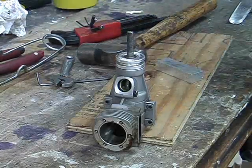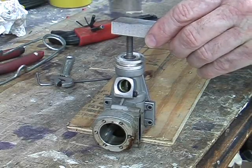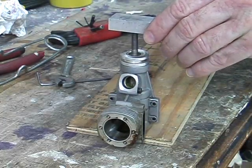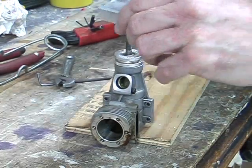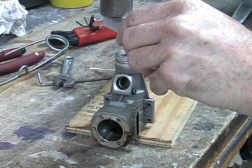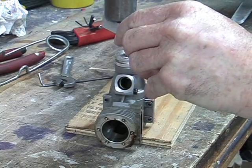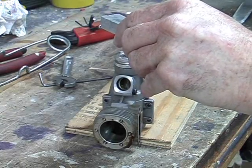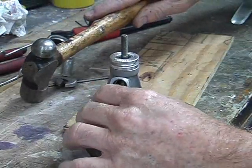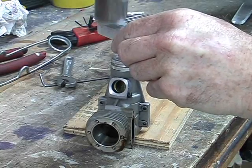Once up to temperature — which should take about 30 seconds — take your block of aluminium, stick it on top of the crankshaft, and give it a gentle tap. It may take a number of taps. I've got this on a piece of plywood so the exhaust stack can fall below the bench level. Take a number of light blows, making sure they're dead vertical so you don't risk bending the crankshaft, and eventually the crankshaft will start to move and drop right out the back.